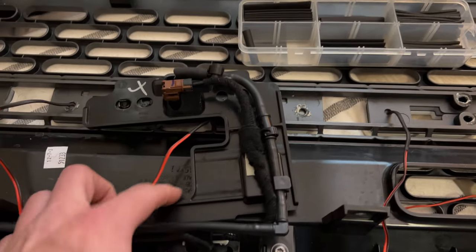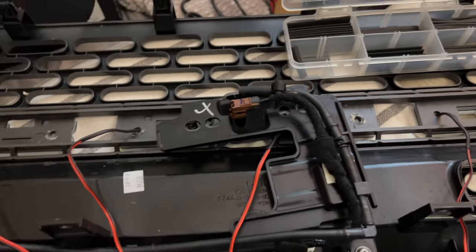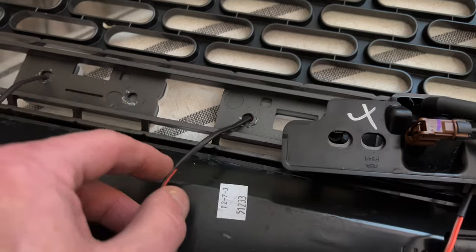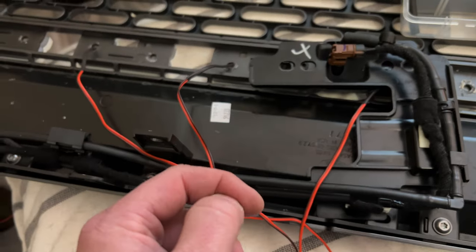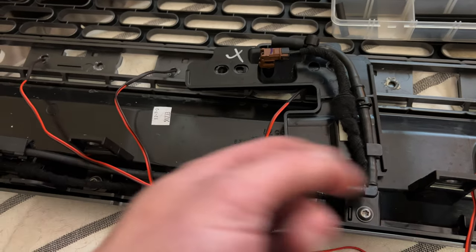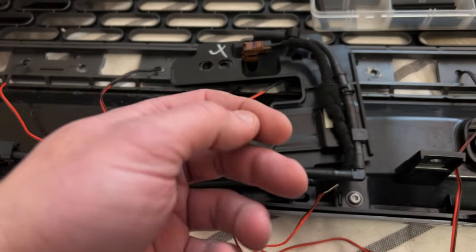I want to run the wires under this piece because whenever I go to put on the winch plate, I'll be relocating this to the front of the winch plate with the JCR off-road kit. Running these wires back behind here means when I do that a couple months down the road, I don't have to redo any wiring — I can just pull this off and it's done. I'm also using heat shrink tubes on the ends because there's a part that's going to go across a screw. I'm running all these cables to one single waterproof connector at the grill, so anytime I remove the grill in the future I just pop the disconnect loose and the grill comes right off.